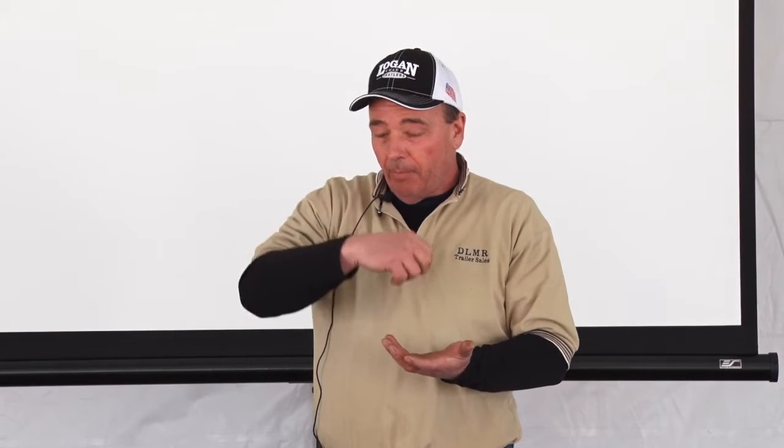So you get the jack down and you get it on the ball. A lot of horse trailers have what I call the clamshell. It squeezes together and the collar slides over the top. Those are really good systems, and they're very durable. Believe it or not, more durable than the ball mounts that have the little lever that you pull up. But the critical thing with that clamshell ball mount, a lot of times you'll notice, man, I'm kicking that thing trying to get it closed. It's tight. It doesn't want to close.